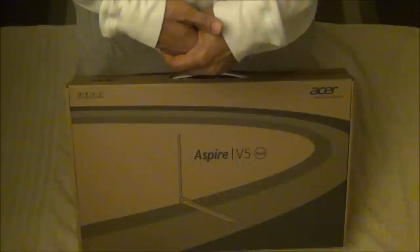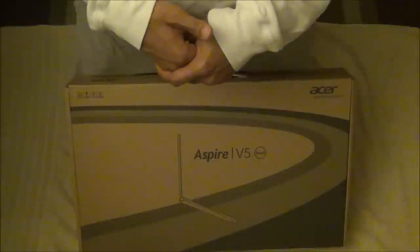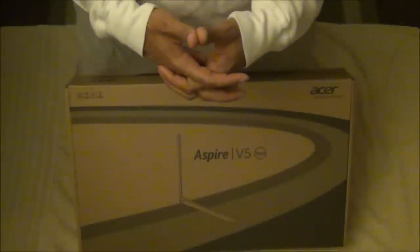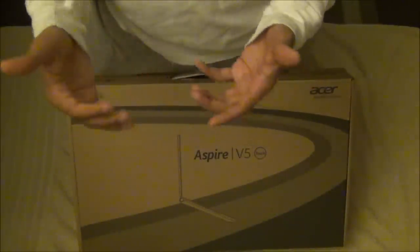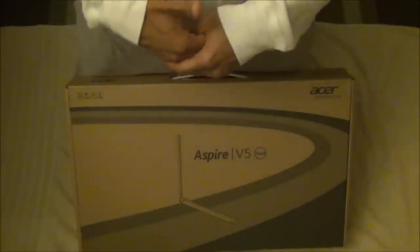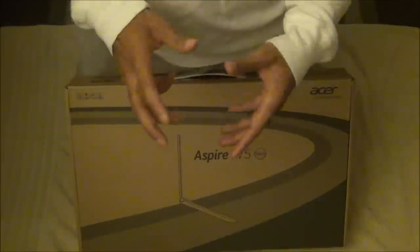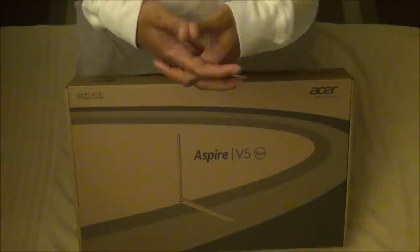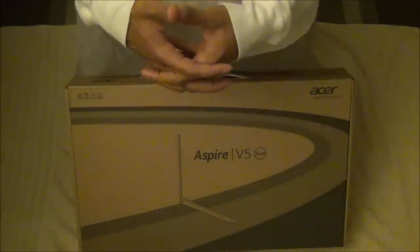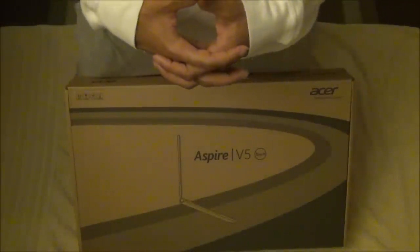This is my first AMD laptop. Processor-wise it has an A10-5757M running at 2.5 GHz, turboing up to 3.5 GHz. The A10 is equivalent to an Intel i3, but when it turbos it's equivalent to an i5 — it doesn't match an i7, but that's fine. It also has dedicated graphics, the Radeon 8750M. The Samsung I had had the 8770M, so this is just below that. It also has the integrated 8650G graphics in the APU, and you can do what's called dual graphics — combining the dedicated and integrated cards for more gaming and video horsepower.